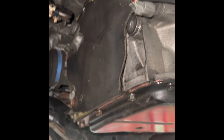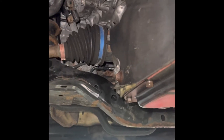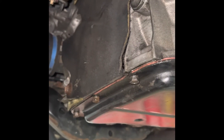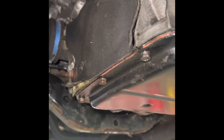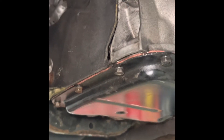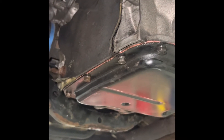Quick follow-up part two — adding transmission fluid on this thing. It does not have a dipstick. Do not use anything but factory CVT transmission fluid on this. I've never bought such expensive transmission fluid — it was $25 a quart.